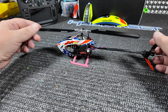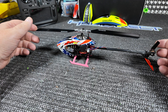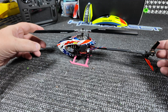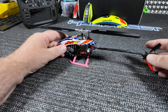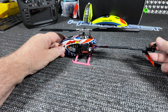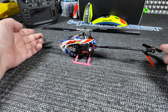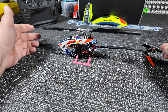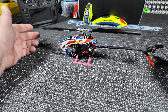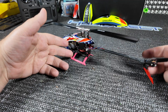100% each way is just too much — it's just way too squirrely. Running this thing even at 50% power is just beyond me, it's too fast. So 35% throttle curve and plus or minus 70 on the collective gives me just about right.